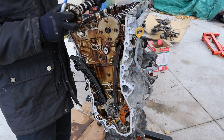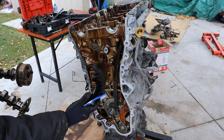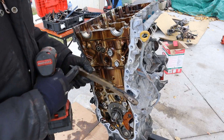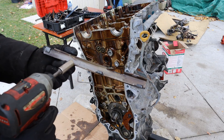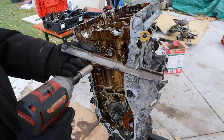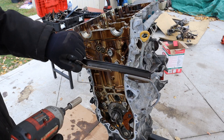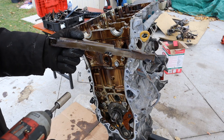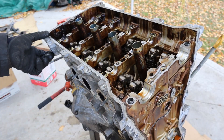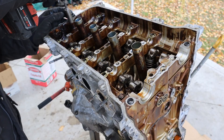While I'm here I'll remove the camshafts — again very simple, pretty lightweight — and then this timing chain slide. Toyota is nice because they're using metal slides with a friction surface in plastic. This is how you're supposed to do it. Audi, Volkswagen, BMW and whoever else — if you make the whole thing out of plastic, of course it'll be brittle. Back at the top of the engine, you'll see that this camshaft carrier is actually a separate piece that has the cam bearings where they ride up on, held by just two 12 millimeter bolts.